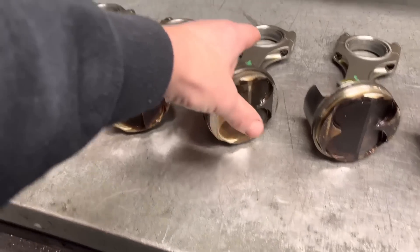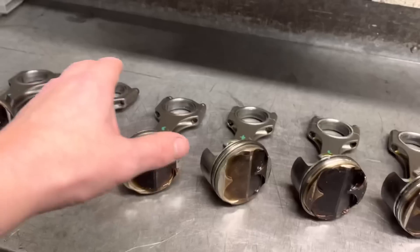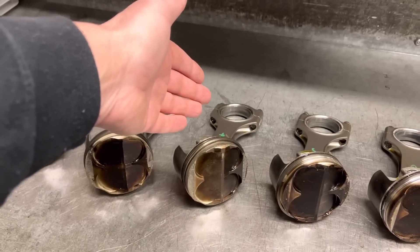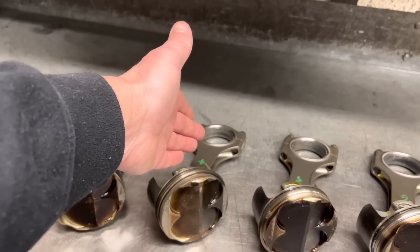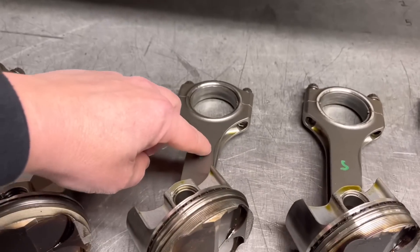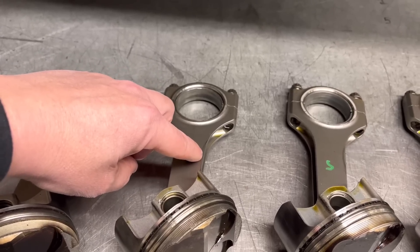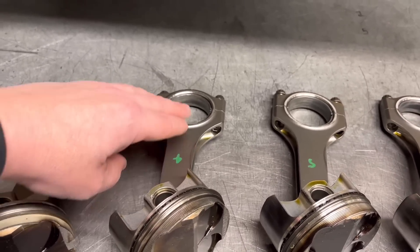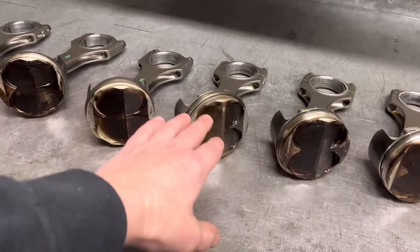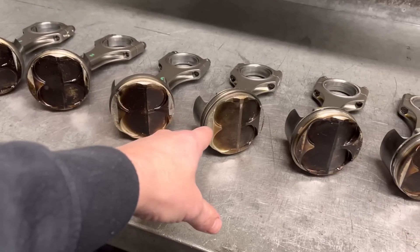The bearings have been wearing very unusually. We know that detonation can cause very strange crank journal bearing wear on the con rods, and that seems to be what it's doing. I did say to you that it's been rubbing against the oil jet, which was obviously very close to these rods, but it does appear that the rod has been moving side to side - and that's almost certainly down to detonation.